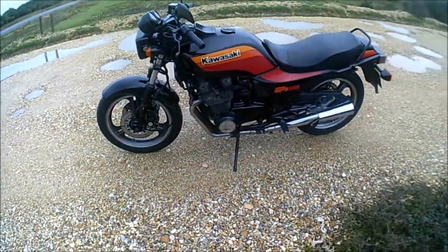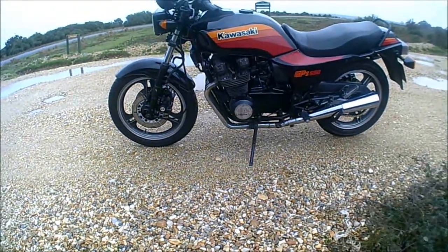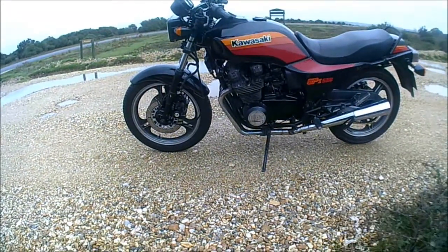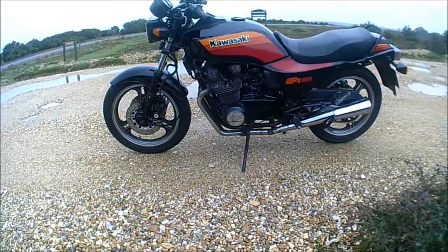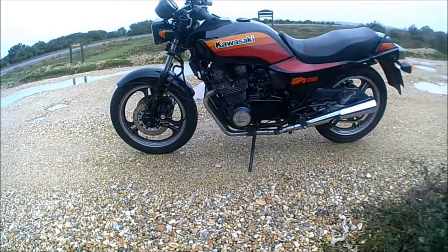Engine itself, it's got 40,000 miles on it, so it's hardly run for one of these. These will clock very easily, no problems at all. As always, I drop the sump out, clean the screen in there, valve job on it, so clearances. Only one was fractionally out, nothing to really write home about.